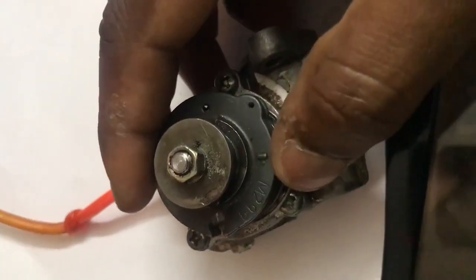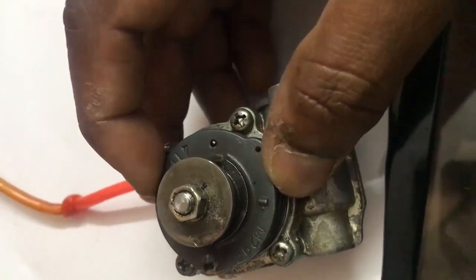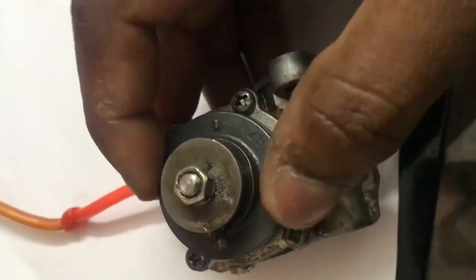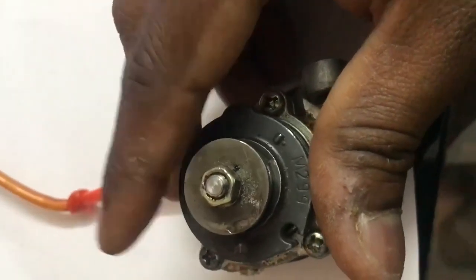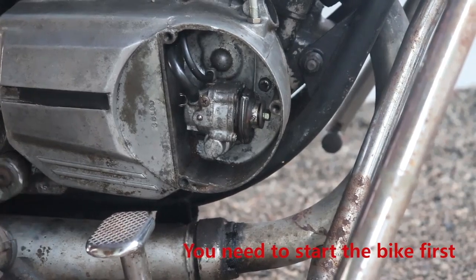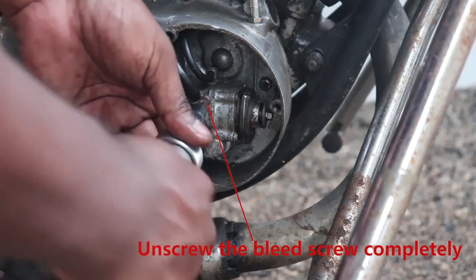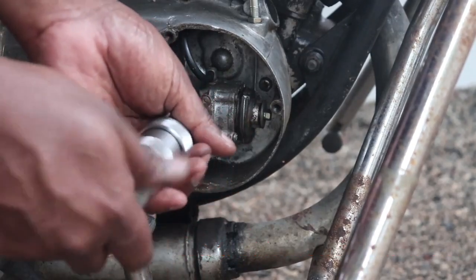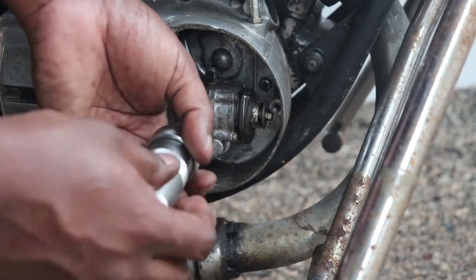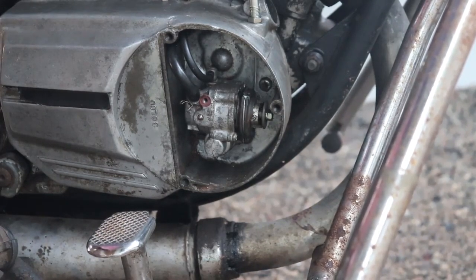The question is: if such huge things can happen, is the oil pump useful at all? The answer is yes, and I'll give you an example why. But before that, let's talk about the premix and how much oil we should put in petrol. The first question people ask is which oil to use. Basically this oil is for lubrication, so if your engine is a daily runner you can use any 2T oil. If your bike is something special, you can of course use very good 2T oils like fully synthetic oils.